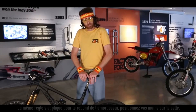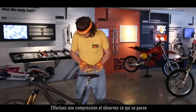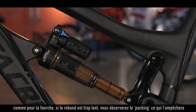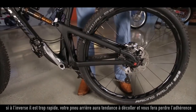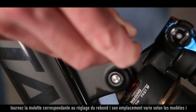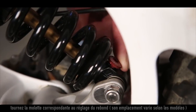Press on the seat, keep your fingertips high in the sky like a butterfly, and watch it return. Just like the fork, if the rear rebound is set too slow it'll pack down and won't return fast enough for the next obstacle. If rebound is set too fast, your rear tire may leave the ground and you'll lose traction. Adjust the rebound as needed — the rebound knobs are located in several different positions depending on your shock model.